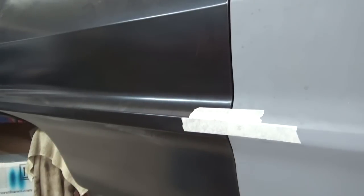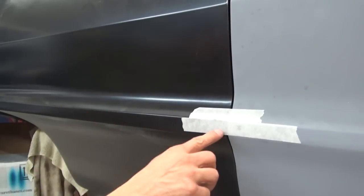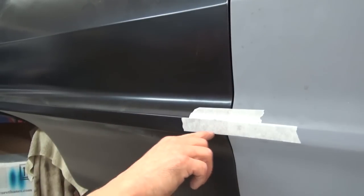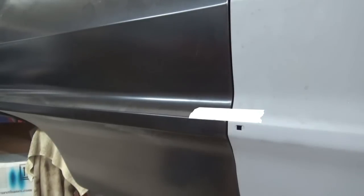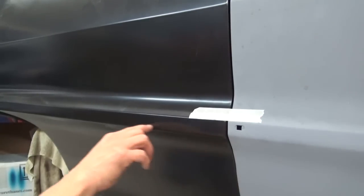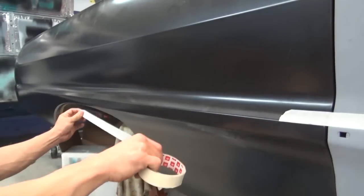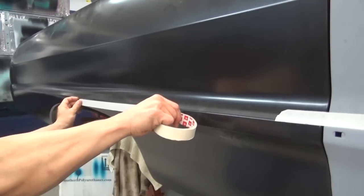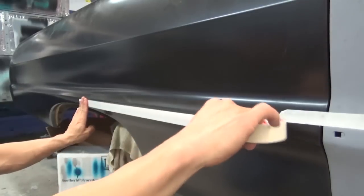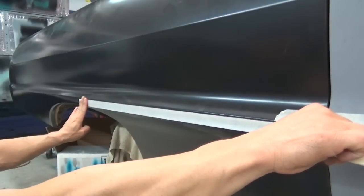So if you line this tape up with that, just kind of line it up there, you notice it lines up here and comes along here, but this is off — you still have this black remaining. So when you close the door you can see the difference in the width of this line compared to this line. What I did is I measured the other quarter panel and just took measurements, marked it here, here, here, and so on down to the end.